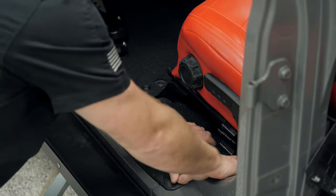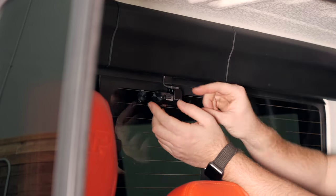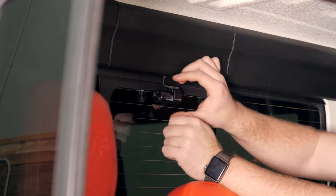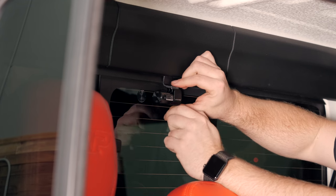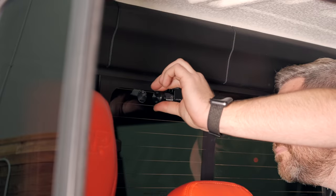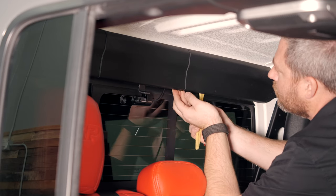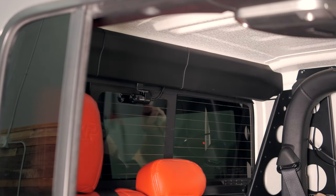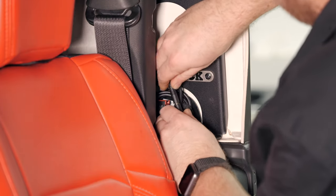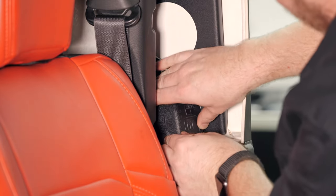I made a small bracket to attach the rear-facing camera to the rear window in the hard top, so the rear camera will remain in place even if I slide open that center rear window. Clean both surfaces with an alcohol pad, then remove the backing from the pre-installed 3M adhesive tape and install the dash camera. Route the wiring from the dash camera up into the trim above the rear window in the hard top towards the driver's side, then run it down to make the connection to the forward half of the wire harness right next to the factory connector for the hard top. This is a great place to hide any additional wiring.